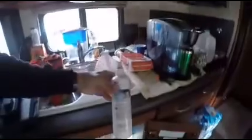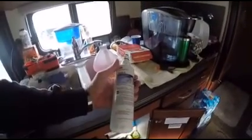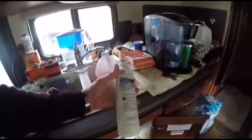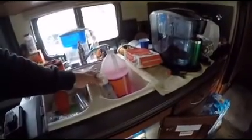The nice thing about doing videos and reviewing them is you realize sometimes what you forgot. It's very important. One last thing in winterizing is that you remove all water filters that you have. And we do have one under the sink right here. And take it from me, it looks just like this. But just unscrew that. And what I did is I just tipped it upside down in a cup and just shook it out, and that usually makes all the water come out of it if you're going to reuse it.